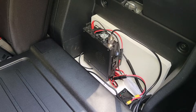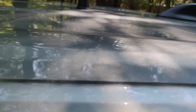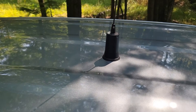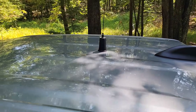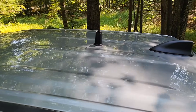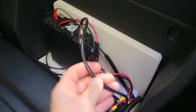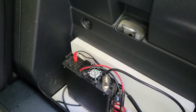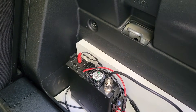The radio is on a shelf and I'll remove it in a minute. You can see the antenna mounted on the roof — real nice work by these guys — with a cap that comes off and goes on it. It's a standard setup right in the middle of the roof, so I'm getting a good ground plane. The antenna wire comes up through here, and I've also got an auxiliary speaker that goes under the seat, bolted in under one of the seat bolts — I'll show you that up front.